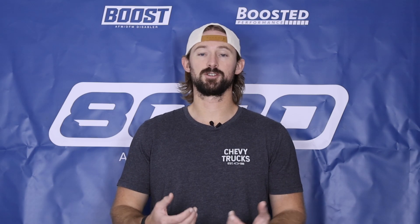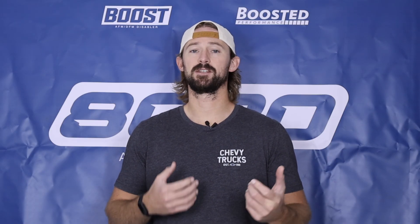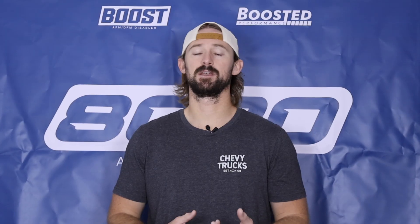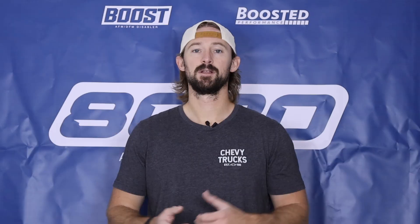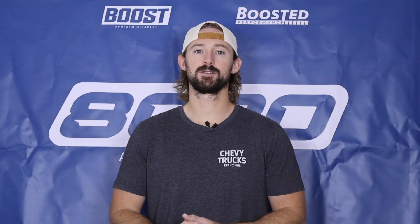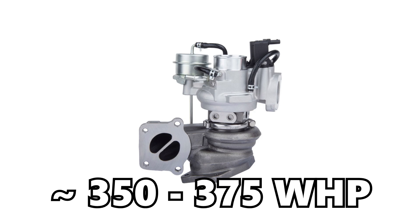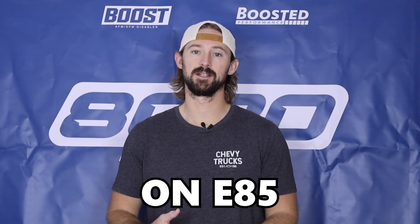The LTG engine is very strong. It has a forged crankshaft, and it is a single-turbo direct-injected engine. The stock internals can handle right up around 400 wheel horsepower before you start to run into internal issues. Above 400 wheel horsepower and 400 wheel torque is when bent rods start to become a concern. Also, to push beyond those power limits, you're going to need a larger turbocharger, because the stock turbocharger caps out at about 350 to 370 wheel horsepower on pump gas and about 400 wheel horsepower using ethanol blends.